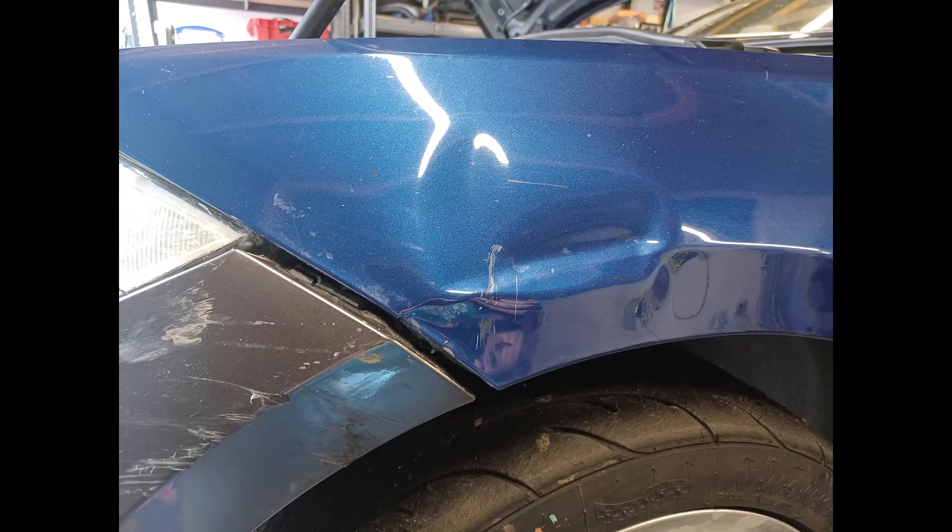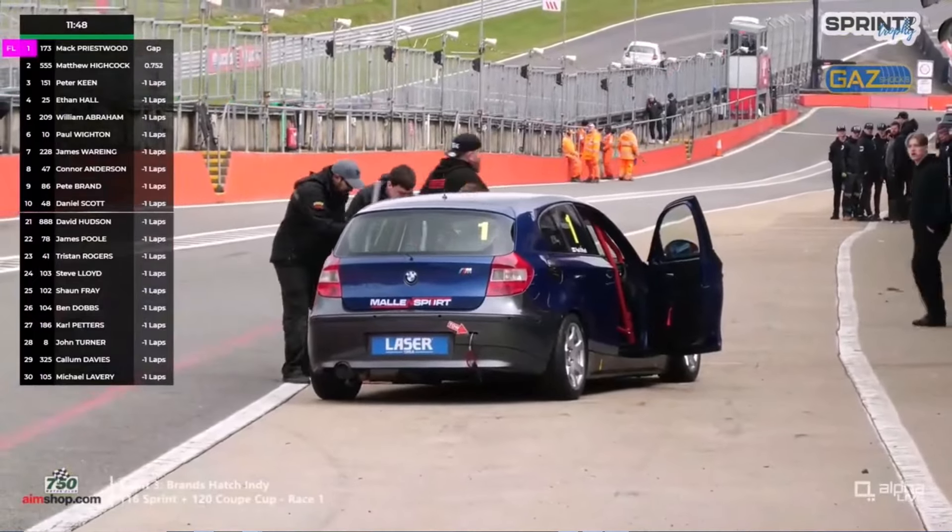The other thing you can't really see here is if you go further around the wheel arch, it's slightly distorted. I've banged that back to straighten it out but that makes it pop out further at the front, so I need to relieve that pressure where the dent is.